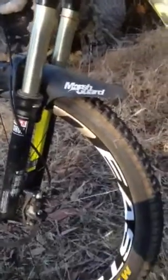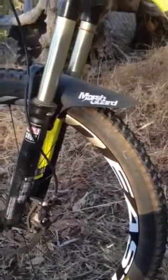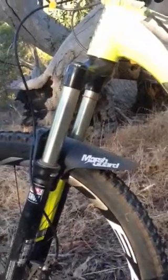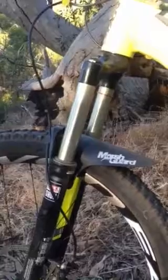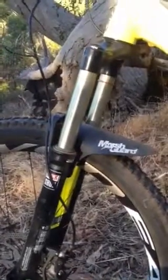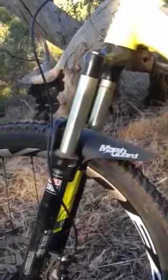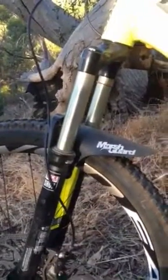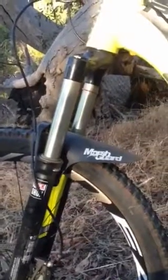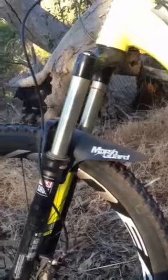Have a play in the car park with your rebound. Slow it down until it just becomes almost inactive, almost not playful, and then click it back on once until it just becomes playful again. So it's kind of rebounding back and forth freely without being fast and not so slow that it's wallowing. Try that front and back, see how it feels, and then you can click back and forth either way.